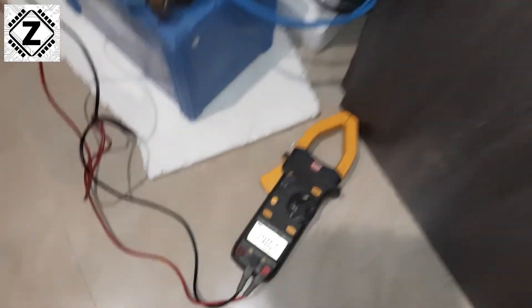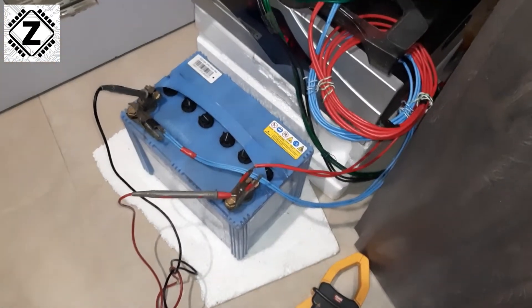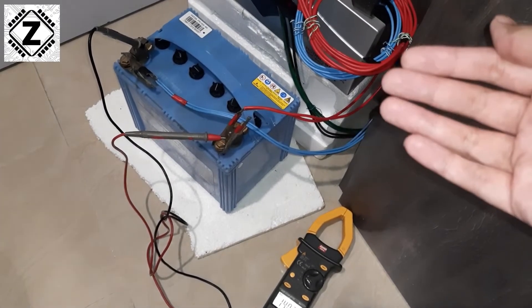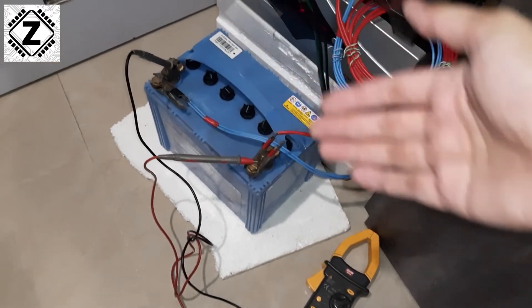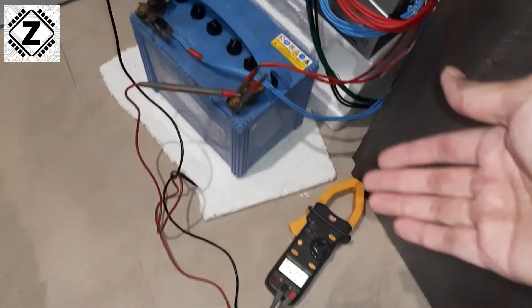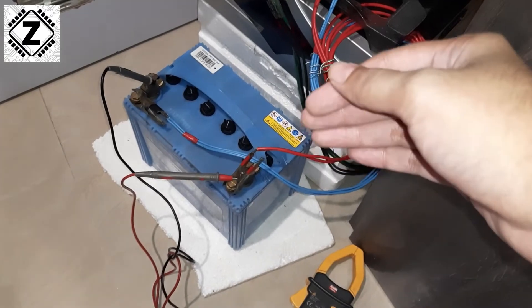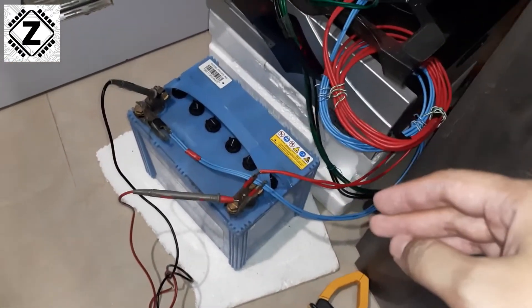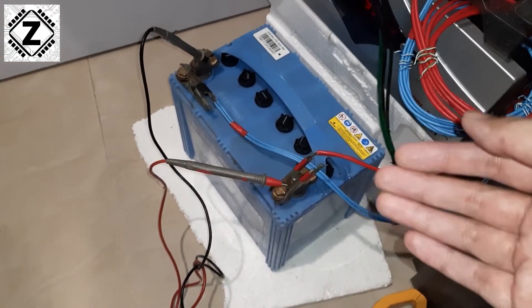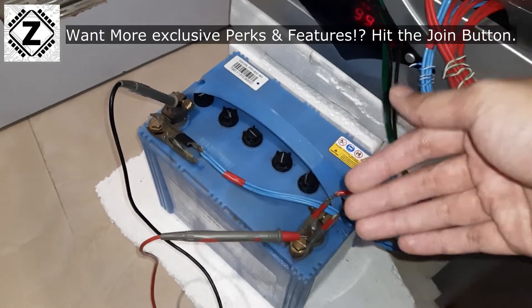The charging is going well — the battery has reached 14 volts and should be fully charged at 14.4 volts by evening. During the charging process, never put any load on the battery; just the charging process should be happening. A voltmeter is fine, but nothing else. Also watch for temperature. If the battery is faulty, it may overheat, feel warm, or you may see vapors or bubbles coming out from the cells — if that happens, disconnect immediately and take the battery outside.